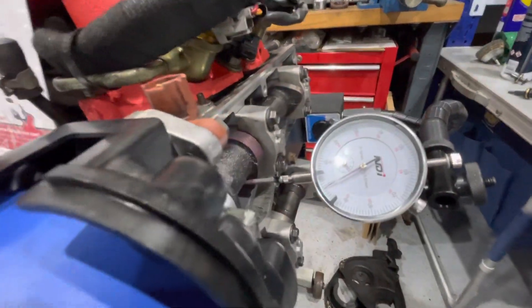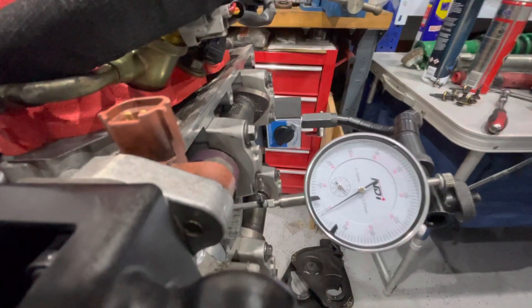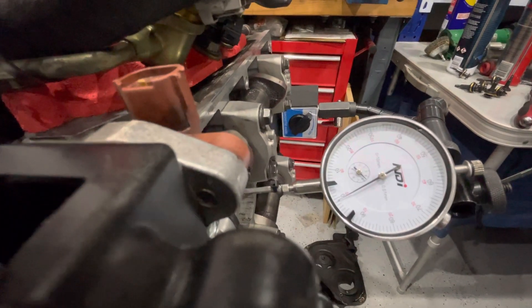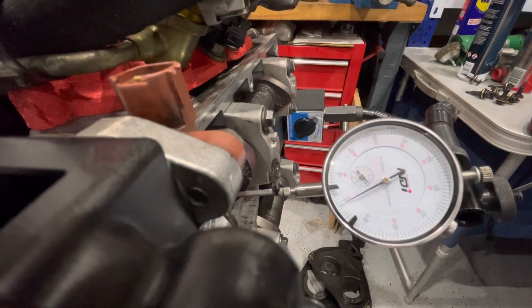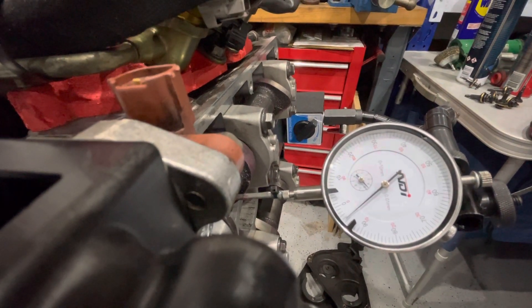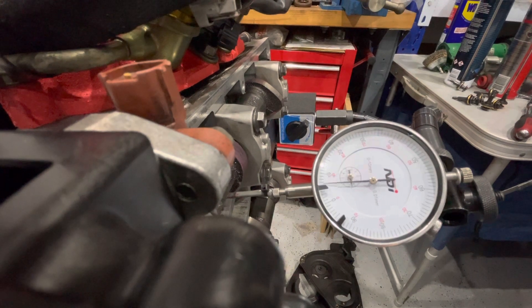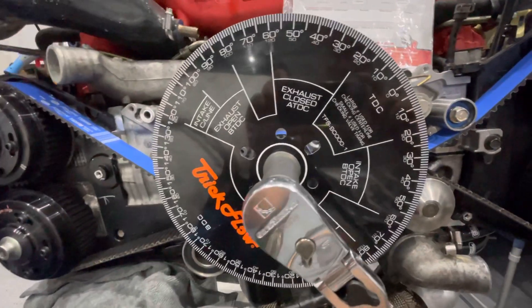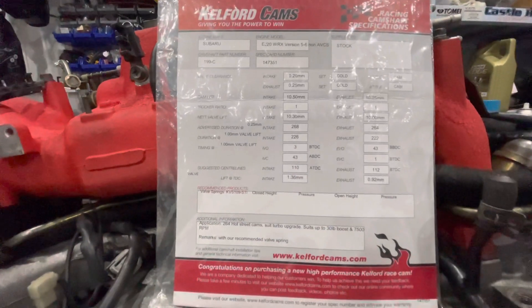So this is just about to open. And if I can show you the gauge here as I turn the motor — it is zeroed, though it doesn't have to be zeroed. It's more about one millimeter after the valve is opened. So now you can see the valve is starting to open. You want to make this back to zero here. That's one millimeter open. I've come to the wheel here — we can see we are three degrees before top dead center. Bang on. Three degrees before top dead center.